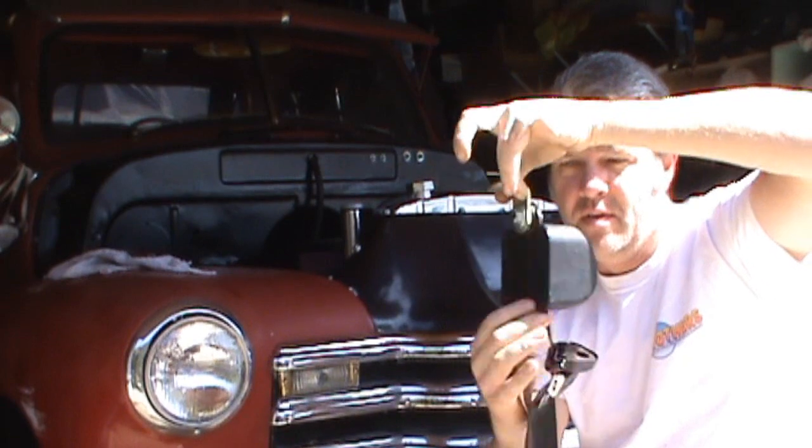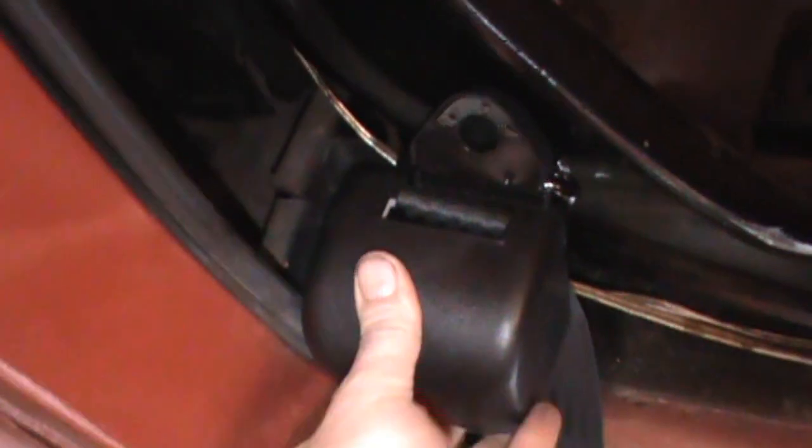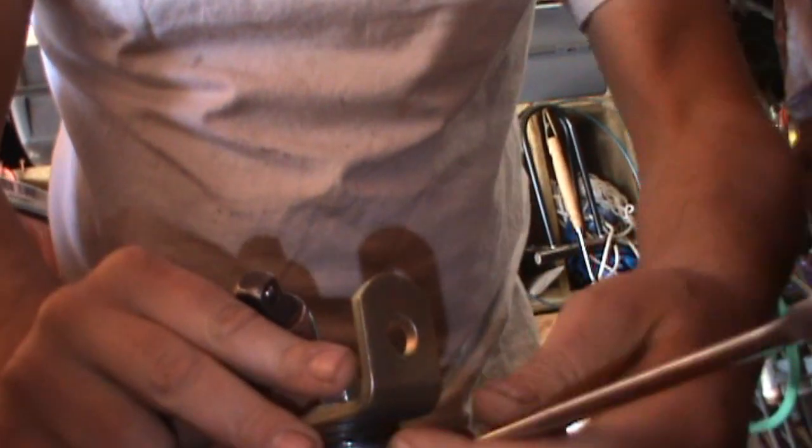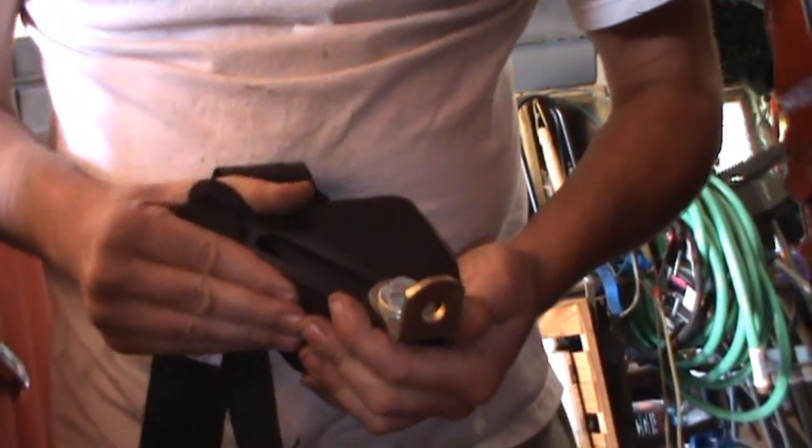Now I'll show you what we do inside the cab. Normally on most cars you would simply put this right about here, but the problem is that with the seat frame in here this won't work because you won't be able to shut your door — you can see it sticks over. So what we're going to do is go behind into this little corner right here. Tighten this down first to make it easier to work with. I like this bar slanted forward towards the seat, with the bracket going straight down. You can see how your seat belt is going to fit back there, so we'll mark the hole right there and drill it.